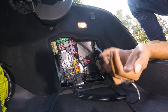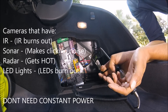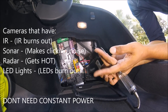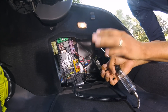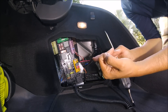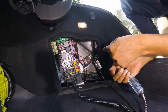The camera that won best camera under $30 does not need to be constant powered because it uses radar. Radar gets hot after a while of being constantly on and your image will begin to distort once it gets hot enough, eventually blacking out until the camera cools back down. If you have a camera with infrareds, backup lights, or any other accessories besides the camera itself, you want to run it to the reverse wire.